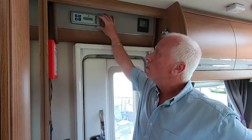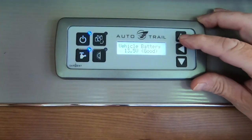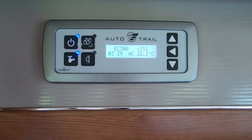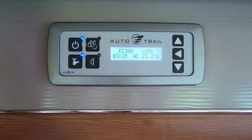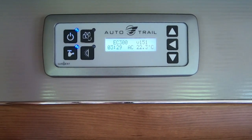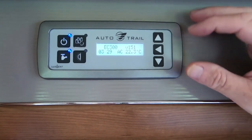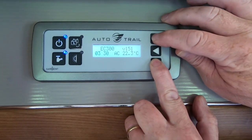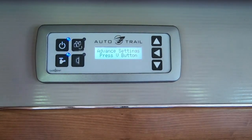The levels on our motorhome are sort of hit and miss — it might say 25% when it's full — however they're just a gauge. Now, to get into the actual setup mode, you need to scroll to the very top to the home screen, which will show you the model number. It's very important that you have the power on and that you're in the home screen — this will not work if you are not in the home screen. Once you're in the home screen, push the top and bottom buttons together, keep holding them, you'll get a bleep, and then the screen will go to advanced settings.